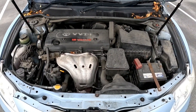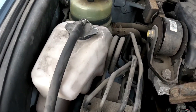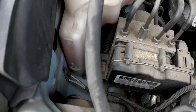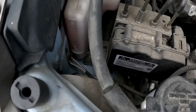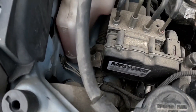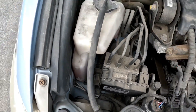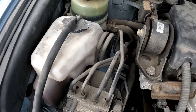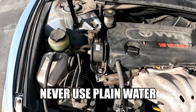This method will work for most engines out there, if not all. The first thing you want to check is your coolant expansion tank. You can see there is a mark for full and a mark for low. You need to check this when the car is cool — when it's cool you want it to be about three-quarters towards the full mark, and once the car is warm it should reach around the full mark. Not having coolant in there could cause overheating; in my case it's currently full.